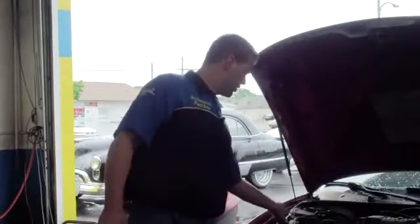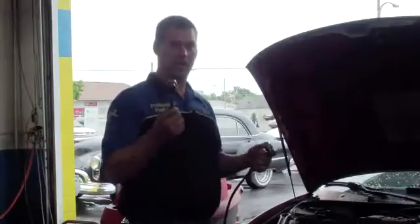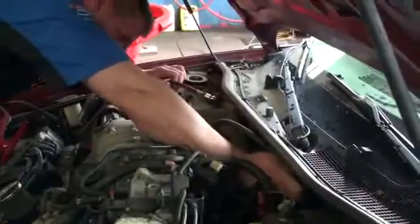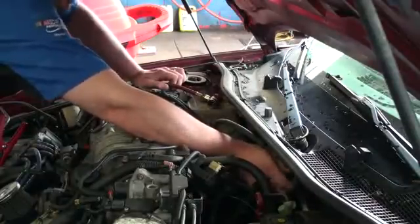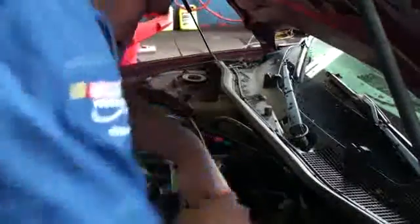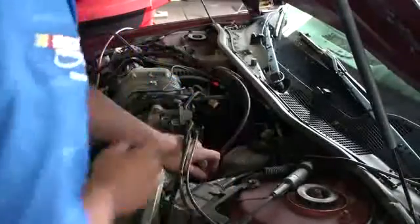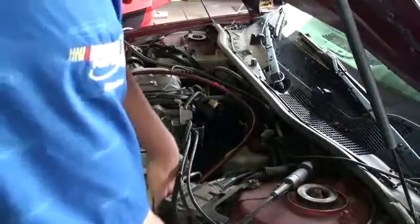You're going to have two hoses: a red hose and a blue hose. The blue hose is for your low side, which is the smaller fitting on the car. The red hose is for your high side, which is the larger fitting on the vehicle. The kits from the store won't have a valve that opens and closes. It would be well advised, if you're doing an AC recharge at home, to buy a set of AC manifold gauges — two gauges with three hoses. The yellow hose hooks to your vacuum pump, which you'll need to vacuum the system down, and also hooks to your AC cans when you fill the vehicle with Freon once it's been vacuumed out.